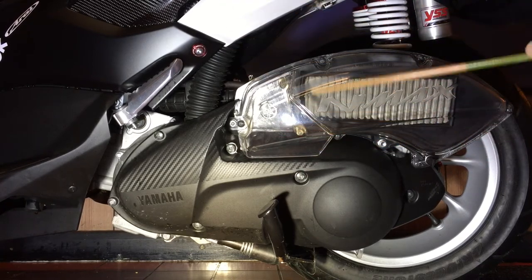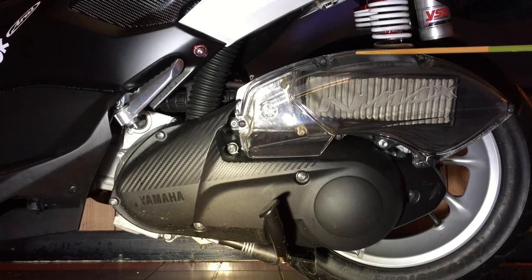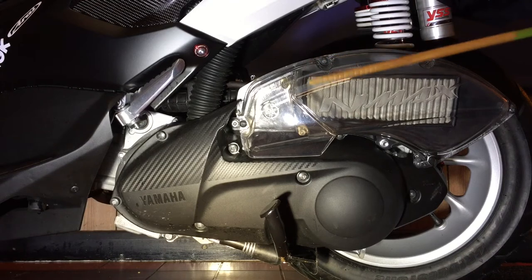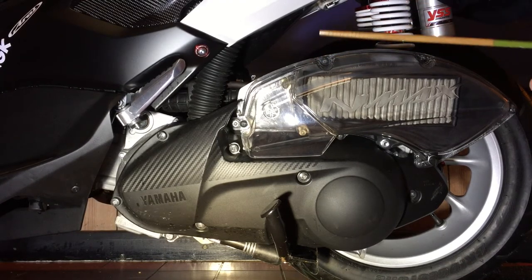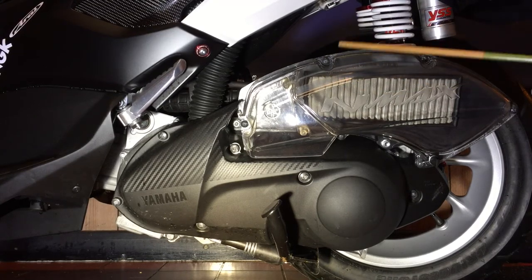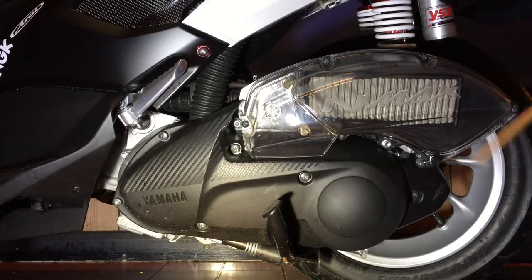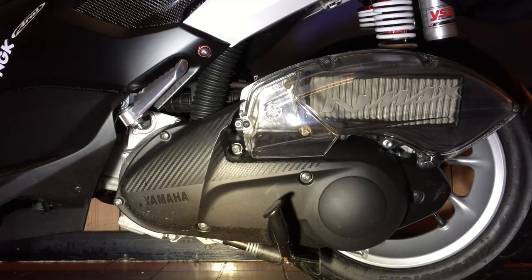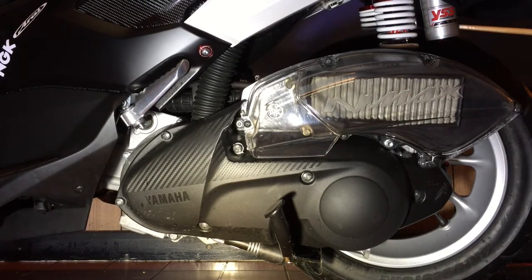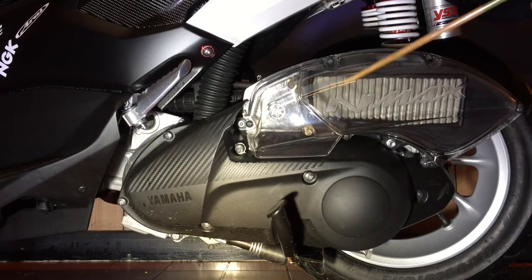If you don't know about fresh air and engines — the cooler the air, the better. Colder air is denser, so it adds to power. On a scooter I wouldn't worry too much about this. If this were a performance bike or a race track bike, the cooler the air you can get the better, which is why on most sports bikes air filter elements are usually positioned further up front.